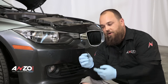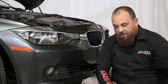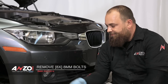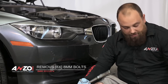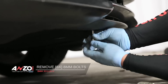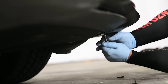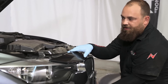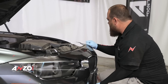Pry them up and then pull them out as a whole piece. You can pull the pin all the way out, but if you do, make sure you don't lose it. There are also a bunch of 8 millimeter bolts down there. Since I don't have a lift, we're going to use the ratchet. Once we've removed the bolts from up top, the bolts on the side, and the bolts from underneath, we can slide this top section out.